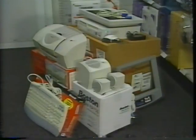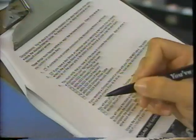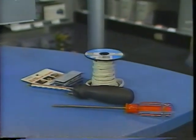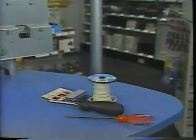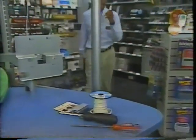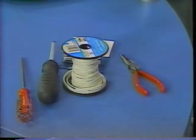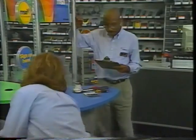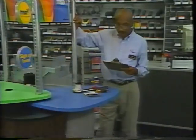After the install is done, you can unpack your computer hardware and start the installation. You'll need flat blade and Phillips screwdrivers, some wire ties, about 6 feet of speaker wire, and a needle nose plier. You're going to mount the monitor on the bracket on the blue tabletop. Let's start there. We're using the floor fixture in our example, but if you have a wall fixture, the same instructions apply. Before you begin, make sure that the electricity to the power strips is turned off.